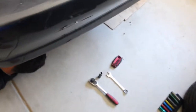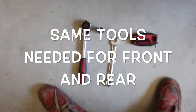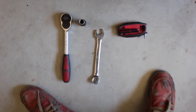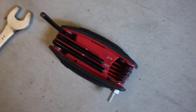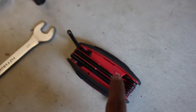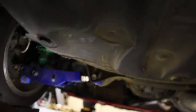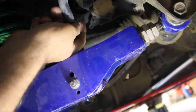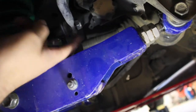Starting here in the rear, the tools you need to take out the rear sway bar are a ratchet of your choice. We are using a half-inch drive with a 12mm socket, a 17mm wrench, and a 3/16 Allen wrench. This might not be the exact right size — it actually might be a metric number — but for this job it will do. He's going to show you the brackets and bolts you need to take out, and then I'll show you the other side.